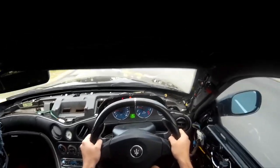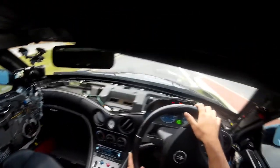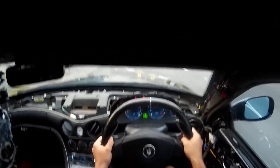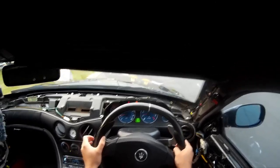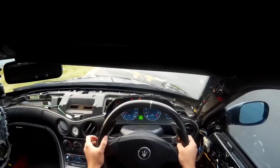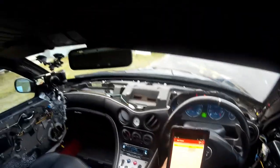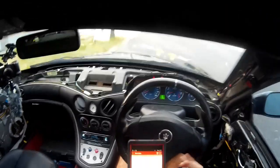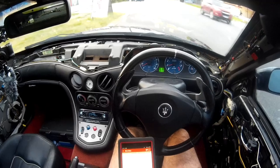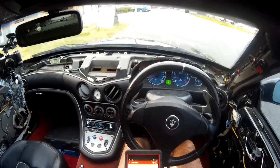In sport mode that clunkiness tends to go away, and I believe that's because of the quicker profile. You might actually be able to run a tighter clutch using the Formula Dynamics module, which I do have the install coming up at some point. I'll just pull over and set a more sensible PIS so I don't burn out my clutch from it rubbing at idle. But you can see that the wear degree has dropped substantially just from setting that very tight PIS. So the clutch wear degree actually tells you what the behaviour of the clutch is, and the PIS is how you control that behaviour.